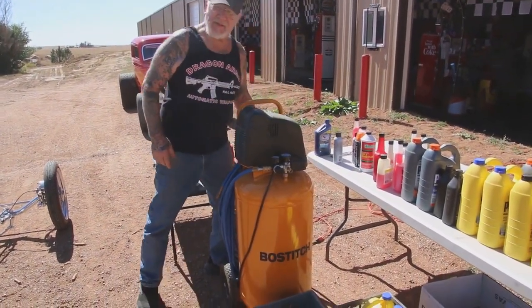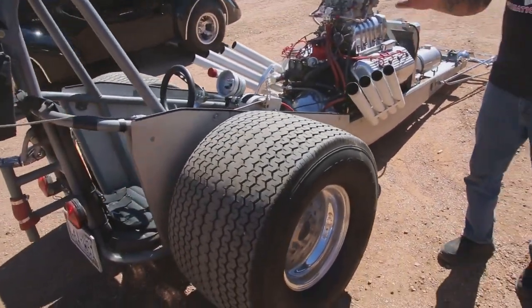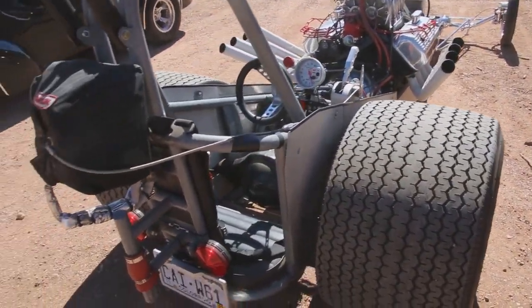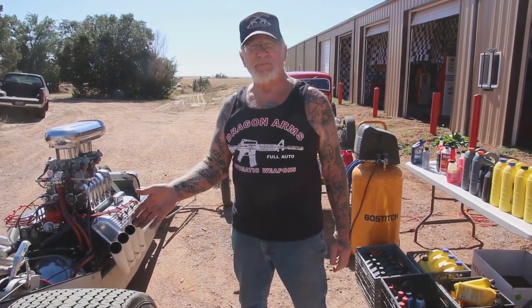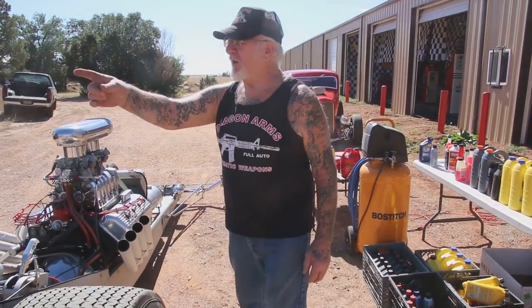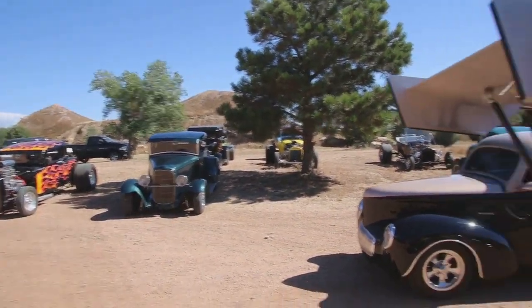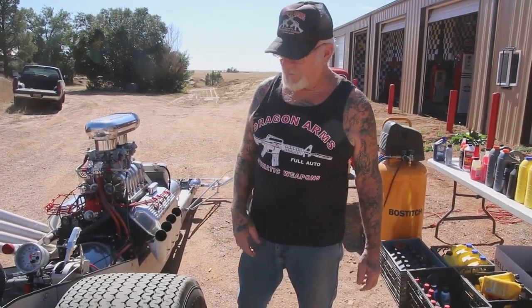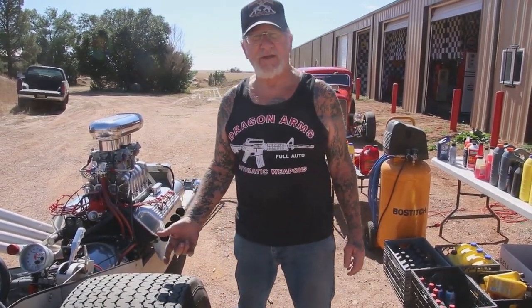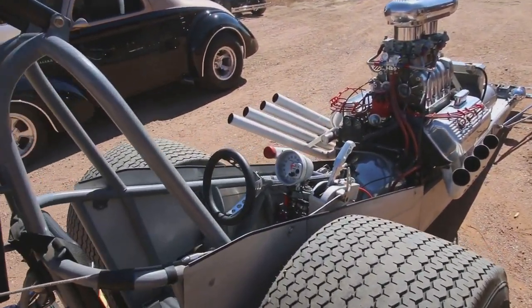These big tires — a lot of people try to put 30 to 35 pounds in them and the whole tire blows off the rim. These big Mickey Thompson tires only get 15 to 20 pounds. Regular tires on regular vehicles get 30 to 35 pounds, but don't overfill the big ones — it'll break the bead and they'll leak. These tires are about $350 each, so you don't want to ruin them.